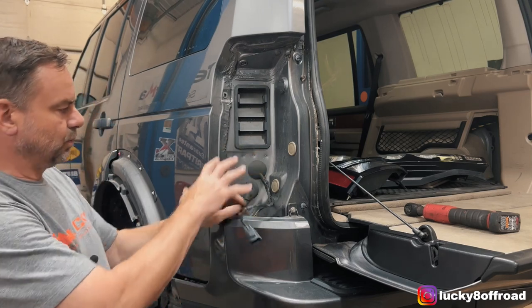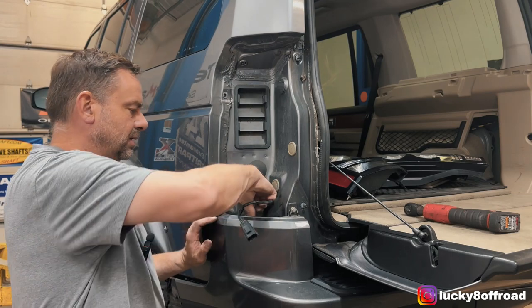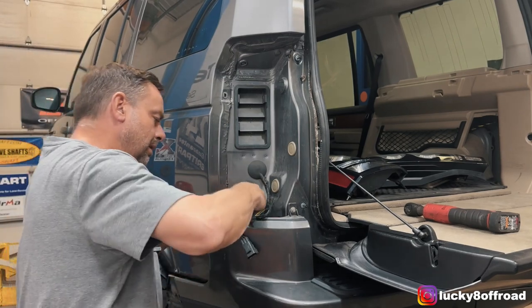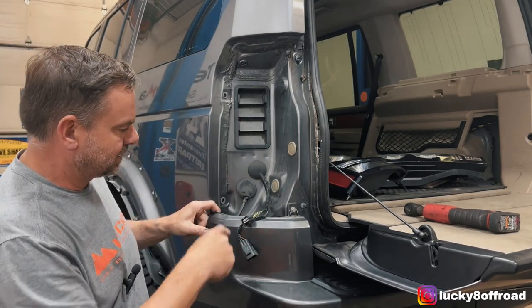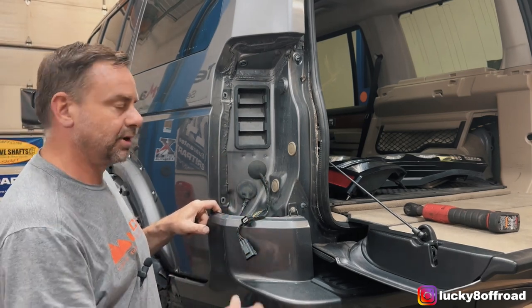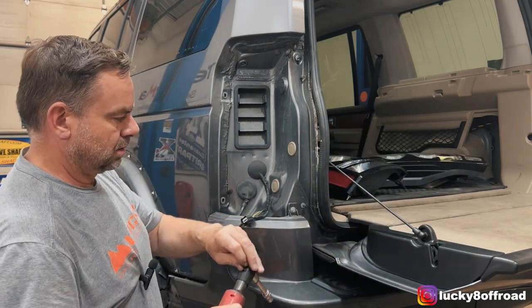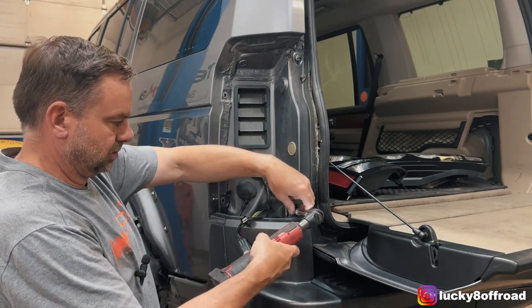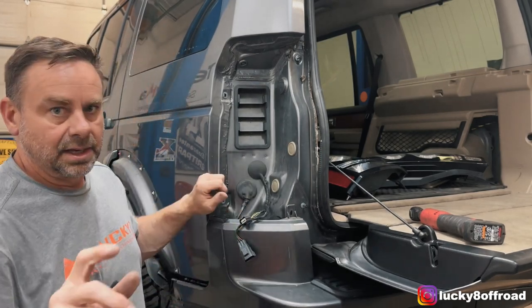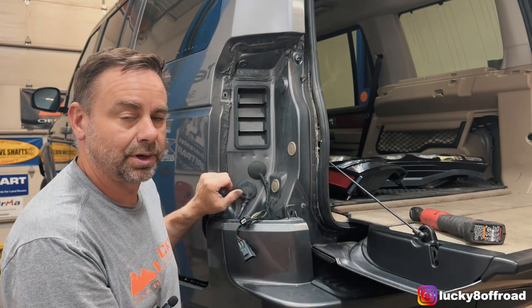Over here on the left-hand side, you want to see what kind of wiring harnesses you have. Some of them have trailers, some of them just have the park sensor. You want to free those up so we can get that out of the way. This one's got a trailer harness. I'm going to wait until the bumper's a little bit more free so I can unclip that one. And since I'm here, I'll pop this 10 mil. Next up I'm going to pop the other 10 mil.